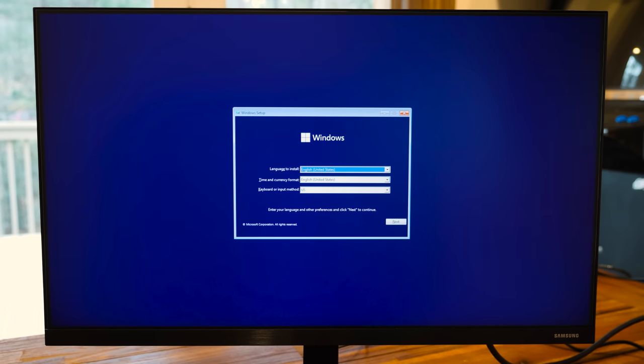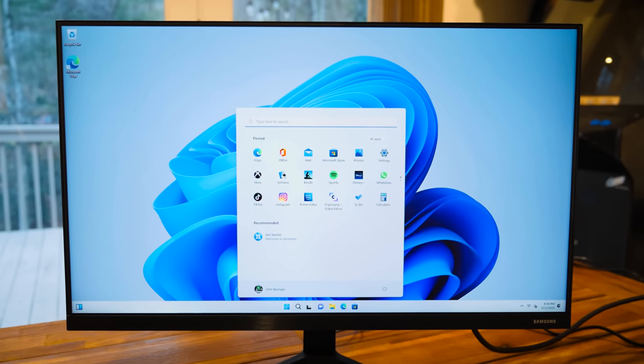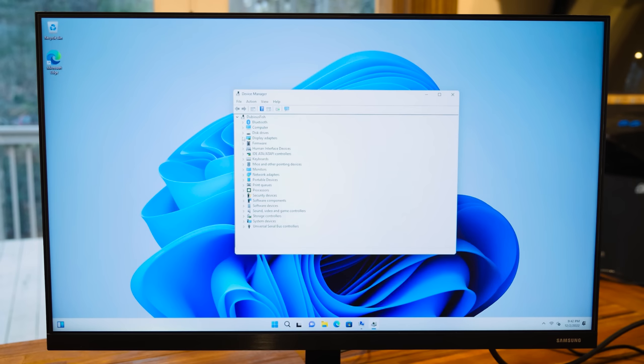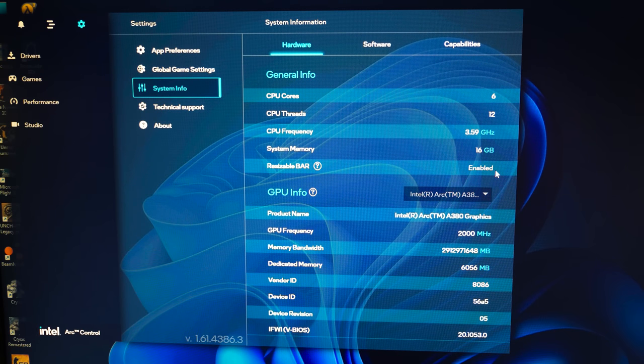On to the operating system. Since I'm in the mood for new things, we're going with Windows 11 — my first time doing a fresh install of it. It's about what you'd expect from modern Windows: a straightforwardly boring experience. Much better than unexpectedly aggravating, so no arguments. It snatched all the drivers it needed online and went off without a hitch. I made sure everything was updated, particularly the Intel Arc graphics drivers, and enabled above 4GB decoding and resizable bar in the motherboard's BIOS, which they weren't — but now they are.